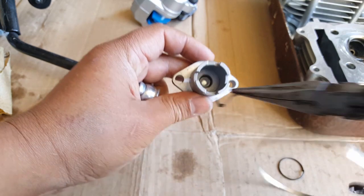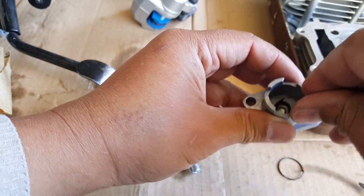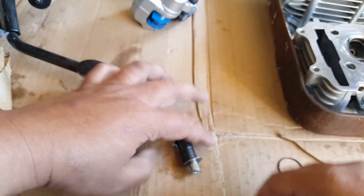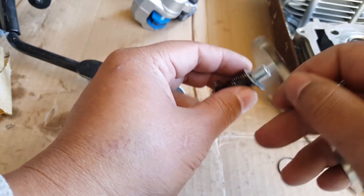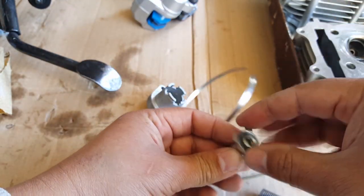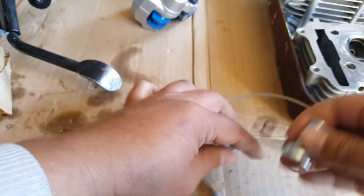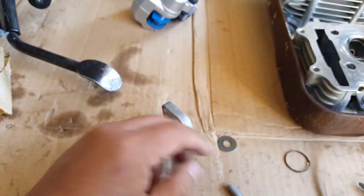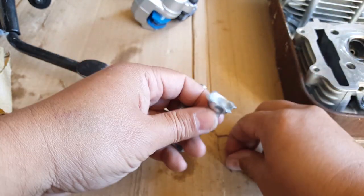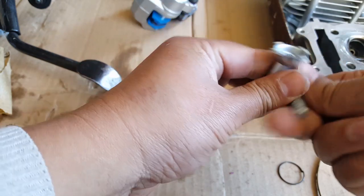All right. So anyway, it would have gone in there, and what happened was it goes in there and winds up. Like I said, once you take it off, it's going to be very challenging to try to spiral this back. And you can see how at the other end it makes its way and latches onto this side, and this gets wound up like this. And this is what gives you the tension, and when you release that flathead, all of a sudden it springs back open and pushes this out again. But the way to assemble it back would be to simply say we've got this wound up already. So what you would do is put your washer, put your spring. Well, put your washer first. The washer needs to protect the spring from popping itself out.